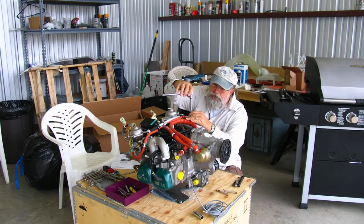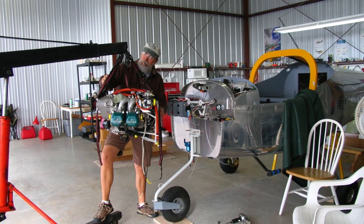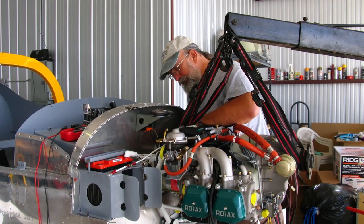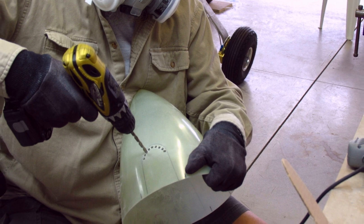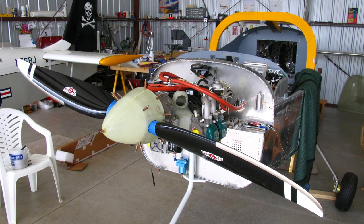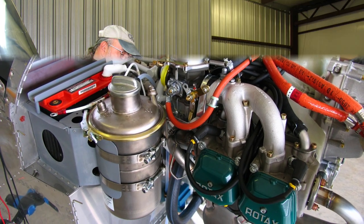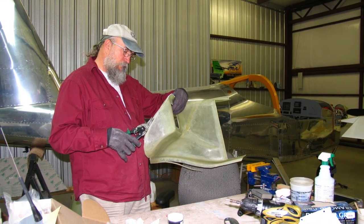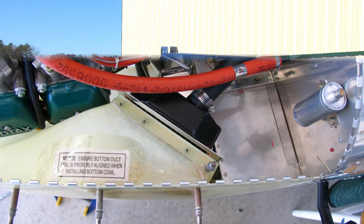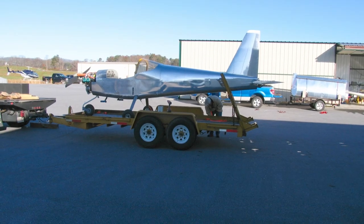At the end of September 2009 the engine kit arrived. After a little assembly, we used a borrowed engine hoist to move it up to the fuselage and bolt the engine into the mount. We drilled out and mounted the spinner and props — ground-adjustable props. We added the oil tank, batteries, all the electrical lines, and here's some cowling ductwork inside the engine cowling.